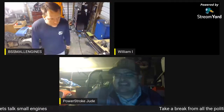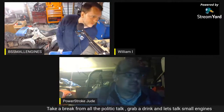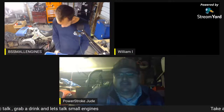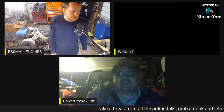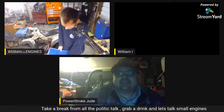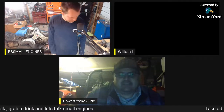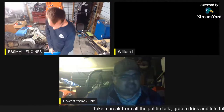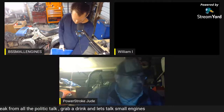So I fixed that. And then I started a big project, which was, like I said, the parts are killing me. So I've been going on it for a little while. I'm spreading the videos out too, but I'm showing straight up the teardown, which is more complete than the going back together. I tore a 6.0 down in my driveway. I drove it into the parking spot, and I tore it down to the bare block. I just took off the heads, took off the intake, took out the evap box, turbo, everything, and now it's all back together. I'm just waiting on a couple of small parts.